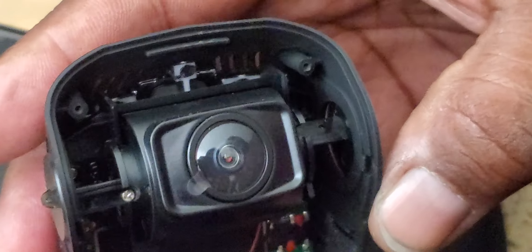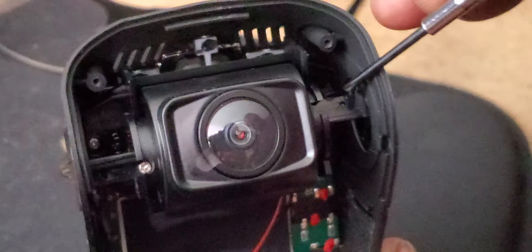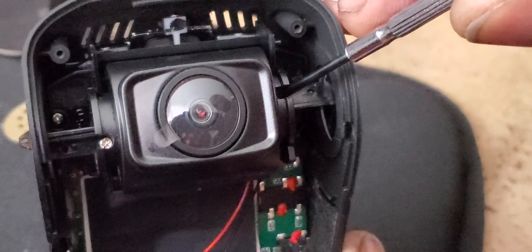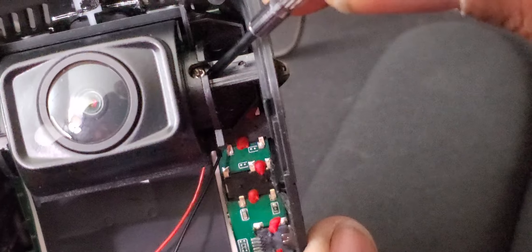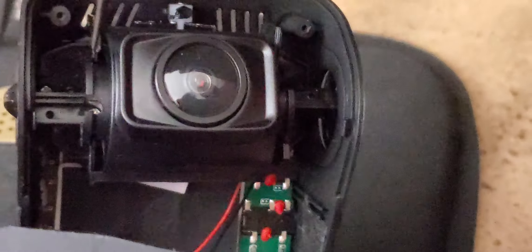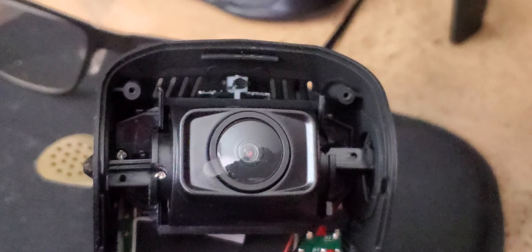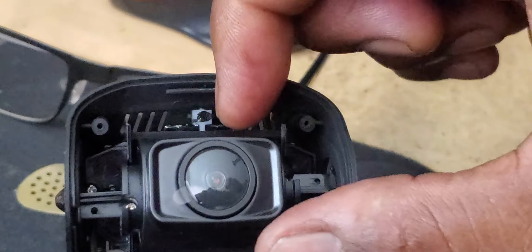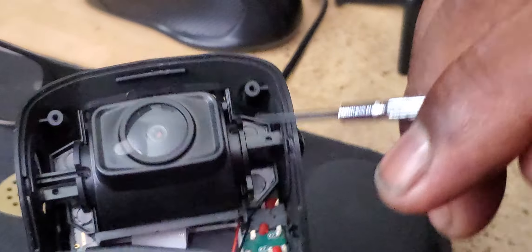If you're opening yours to take off the camera lens, you will see right here an access hole. In that access hole you'll get to one screw, and this access hole on the other side will get you to the other screw — that's how you take off the side pieces, the handles.